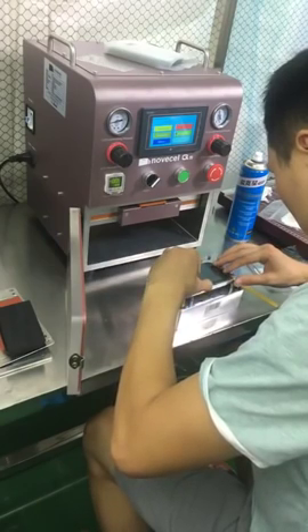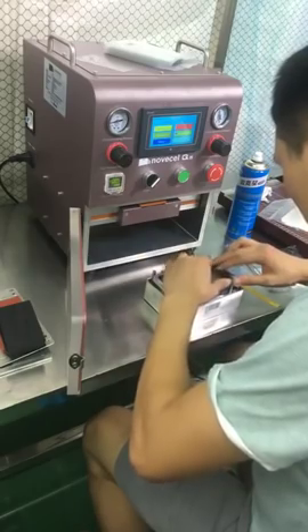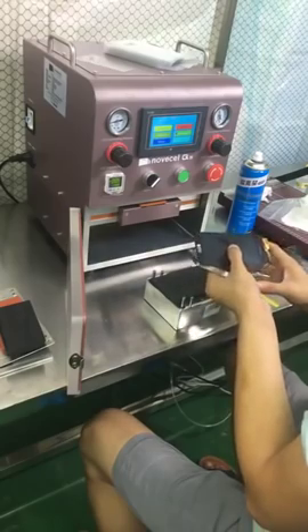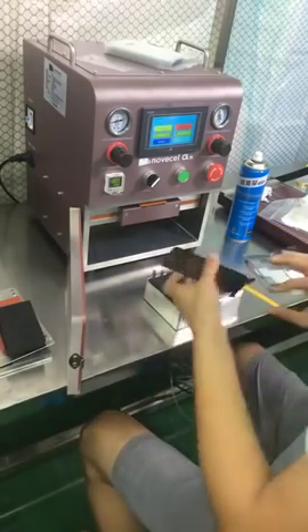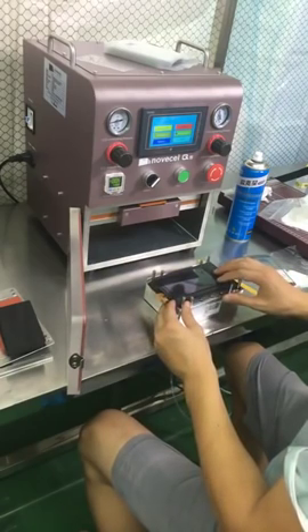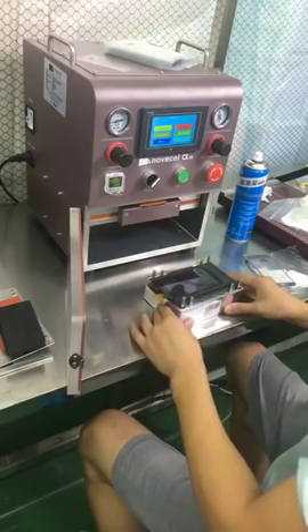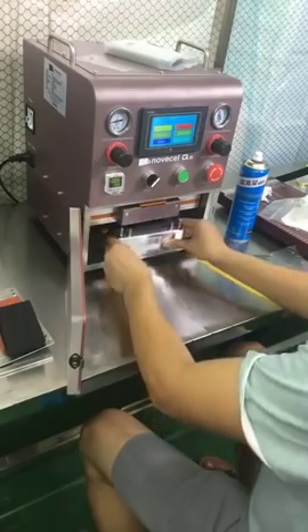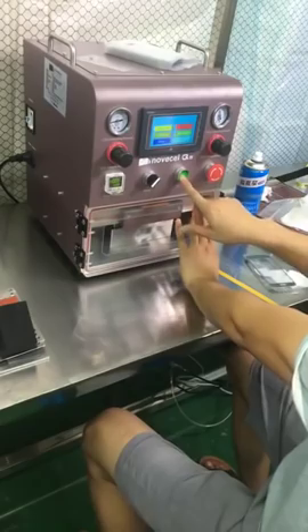Normally the final customer brings you the cell phone, so you separate it and you always have the frame. You can use that frame for alignment and for lamination. If you don't have the special mode, just put the black rubber on it and put it inside the laminator. That's it — easy.